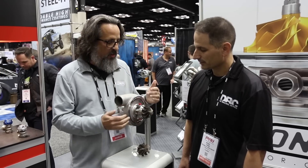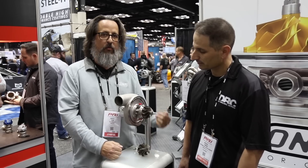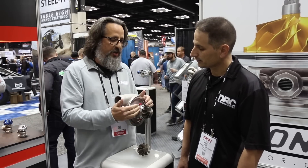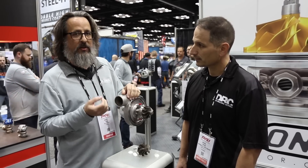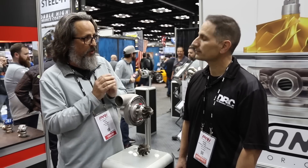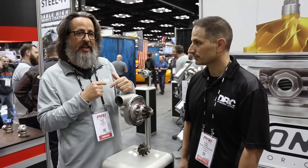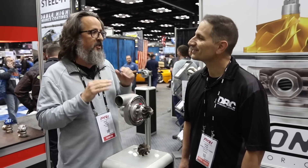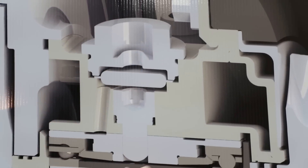This also has one of the largest water jackets I've ever seen. We've made it as large as possible — a complete pancake of water around the turbine side that extends all the way down to the turbine-side piston rings. This keeps piston ring temperature cool, because if piston rings exceed their maximum temperature they'll collapse, lose their springiness into the bore, and start to spin with the shaft — causing major damage in the turbine bore. That's normally what's happening when someone says they've blown a seal. With water cooling right on the piston ring, it's almost impossible to make that happen.